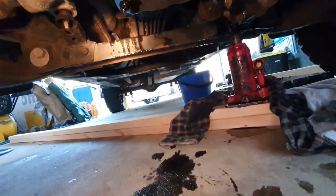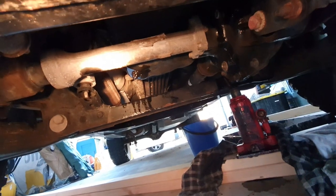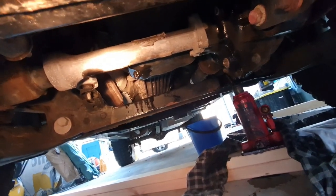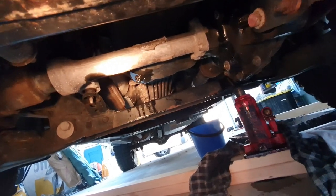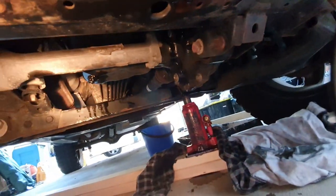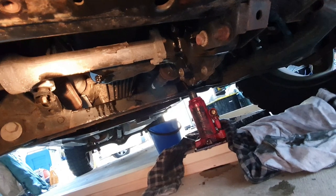As you can see, I've already changed it — spilled some on the ground, silly me. It takes a 16mm or 14mm wrench to open the bolt on the oil sump, which you should be able to access. If you have two people it's easier — one person does the oil filter and you do the oil sump at the same time.